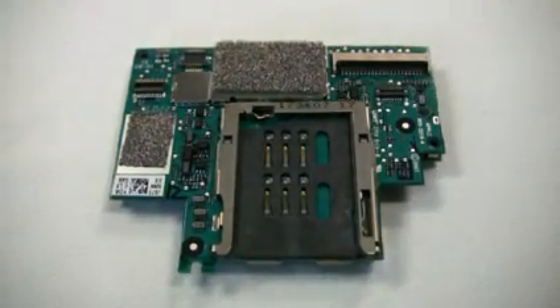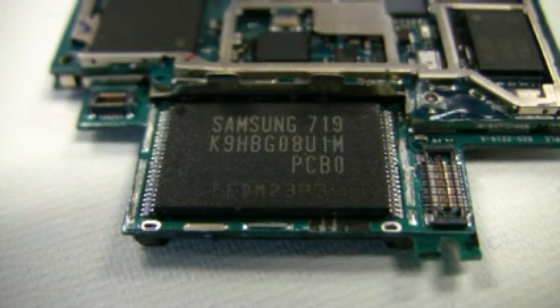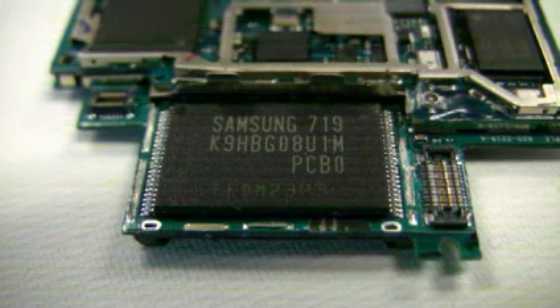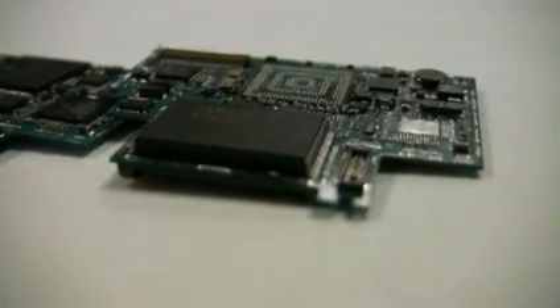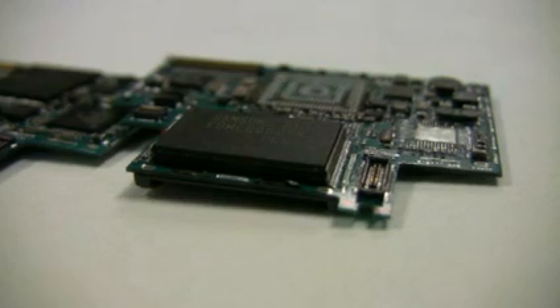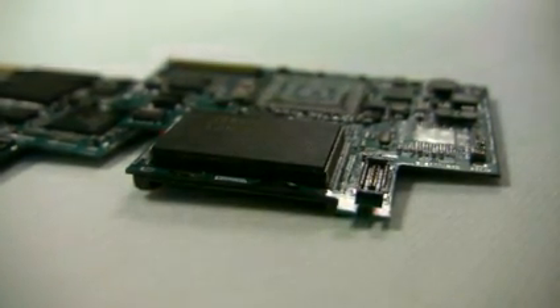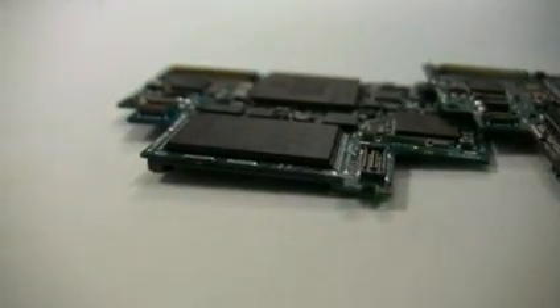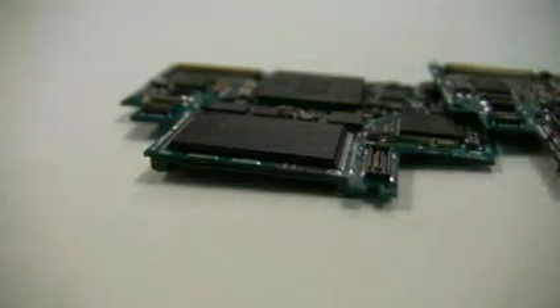Several components are shared between the iPhone and the latest iPod models. Samsung's 65nm 8GB MLC NAND flash was used in the iPhone — interestingly, this is the exact same component used in the 8GB iPod Nano, and is used to store songs, pictures, and videos. The 4GB version of the iPhone also uses Samsung NAND flash. There is also an Intel wireless flash with 32 megabits of NOR coupled with 16 megabits of SRAM, which is necessary for code execution for call functionality.